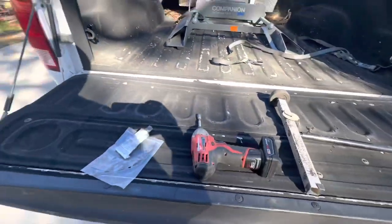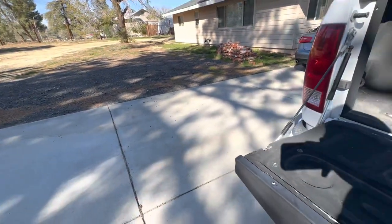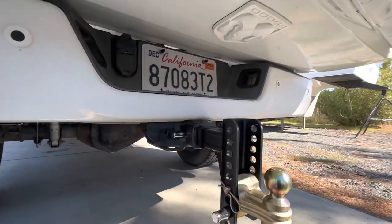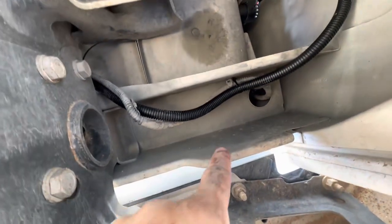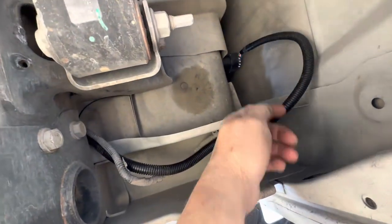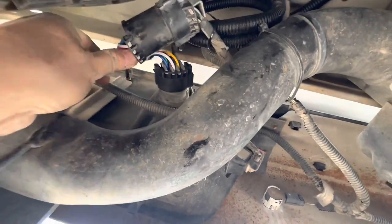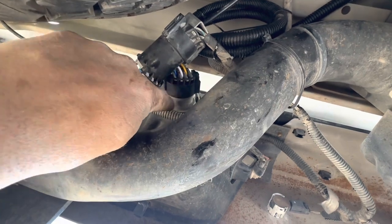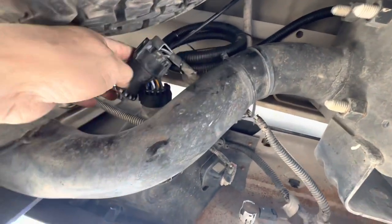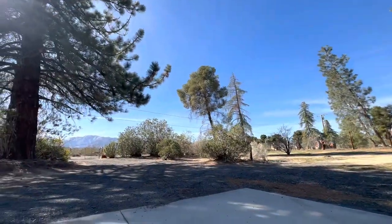All installed — pretty easy. All of maybe a half hour, and that's with getting tools out, getting dielectric grease out, and zip-tying everything. Got it coming out up there, zip-tied to the factory harness which goes to the taillights. Got it zip-tied up here, zip-tied into itself. Put some dielectric grease on the connectors — this connector to this one, and then this connector to the factory one. Pretty basic, pretty easy install. The link will be in the description below.